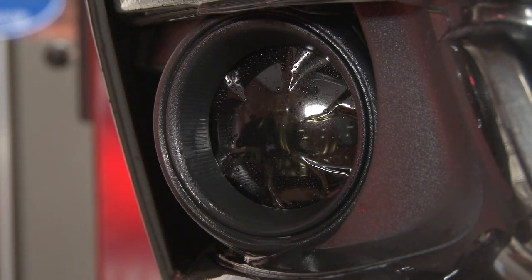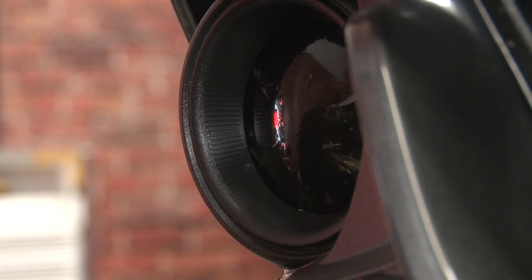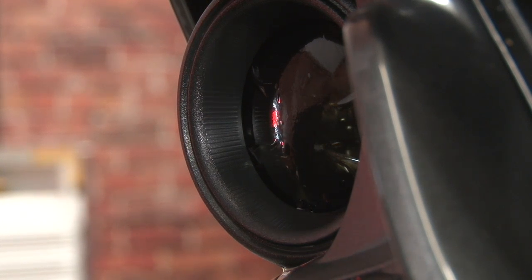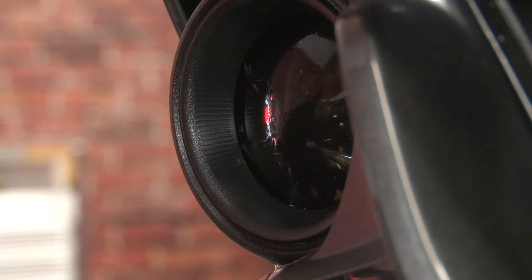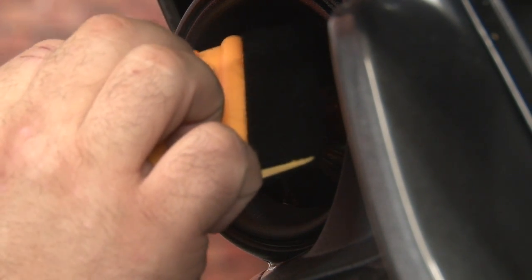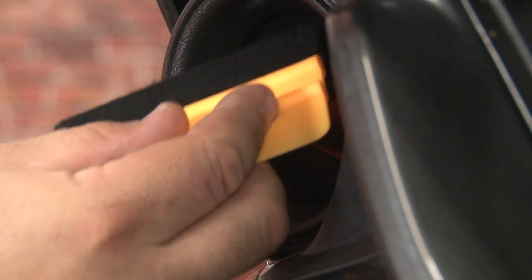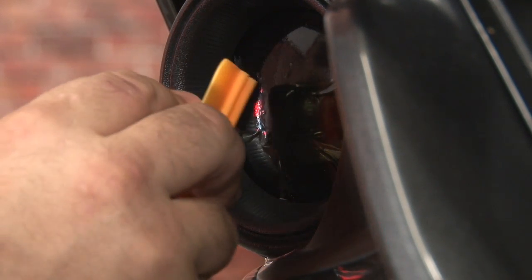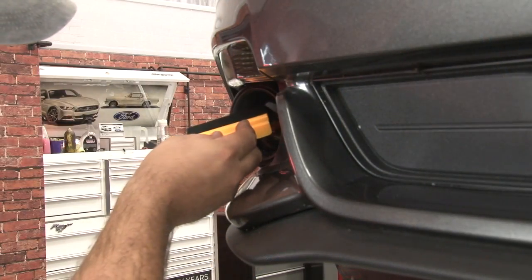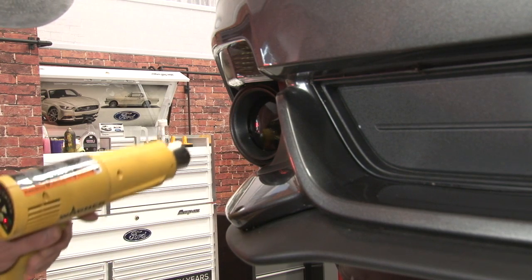You're going to get fingers all the way around — there's no way around it; you just have to slowly work them all out. For this one, if you're using a heat gun, turn the temperature down a little bit. You'll be using a lot of heat back and forth with the squeegee to get the wrinkles out, so use a little less heat so you don't melt the vinyl. Sometimes a wrinkle will go away, you add a little heat, and it might come right back — just take your time and work your way around. When one big finger turns into a couple of small ones, that's actually a good thing; it means it's spreading out.